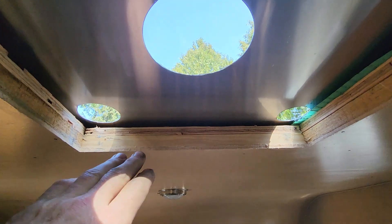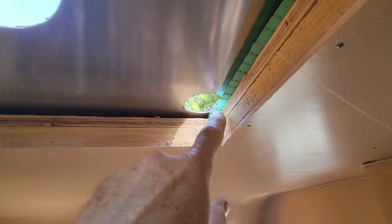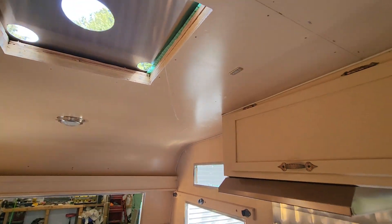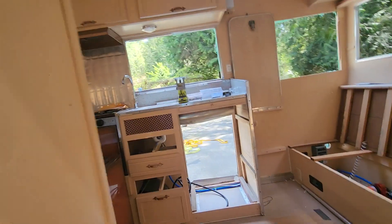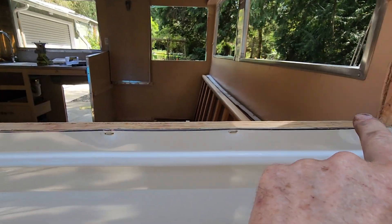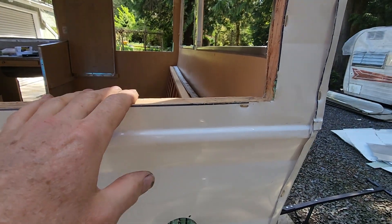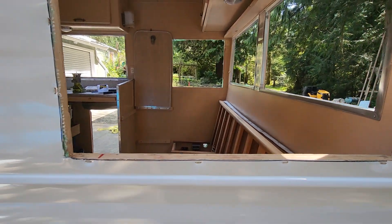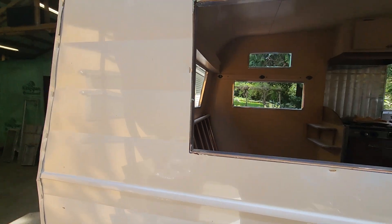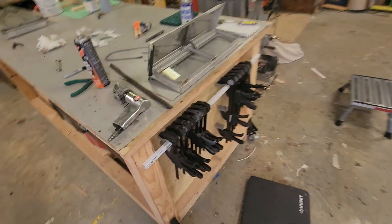For the metal, I just drilled holes in each corner, then go on the outside with a Sharpie, marked from edge to edge, and using some snips you cut out the window edge. I draw a line from hole to hole all the way around, and using pneumatic shears I sheared along, cutting a little bigger than needed, then trimming down as you go to get the exact hole fitting so the window will slip in. Then I stapled it to the frame to keep it intact.